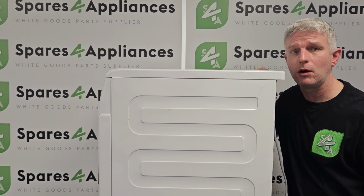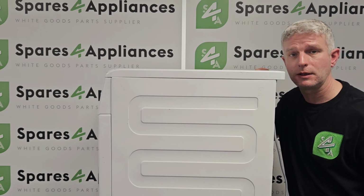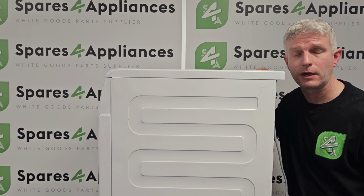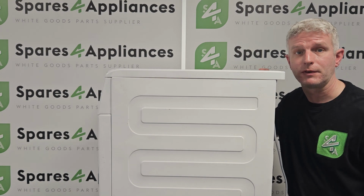And I should point out, all dryers have a capacitor for the motor. It doesn't matter whether it's a condenser, a vented or a heat pump dryer. They all have the same style of motor, they all have a capacitor, and on all three of them it is a common part to fail. So I hope this video helps.